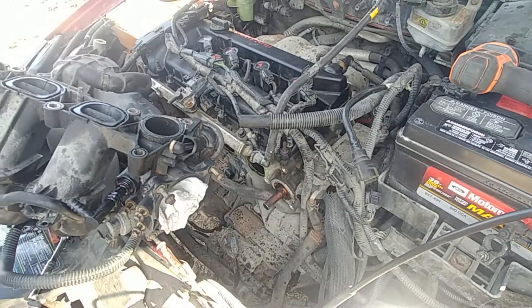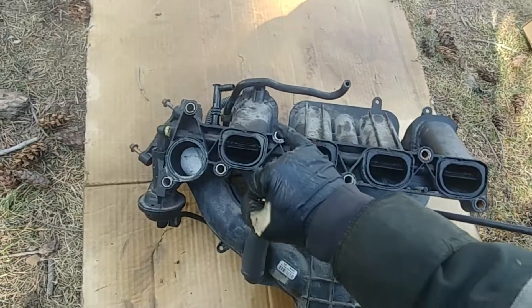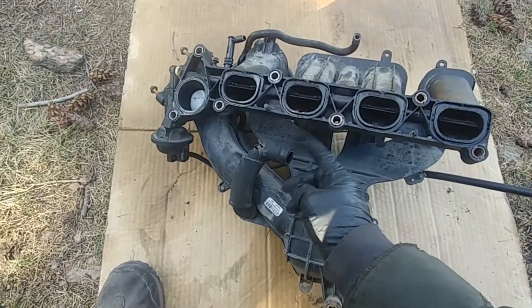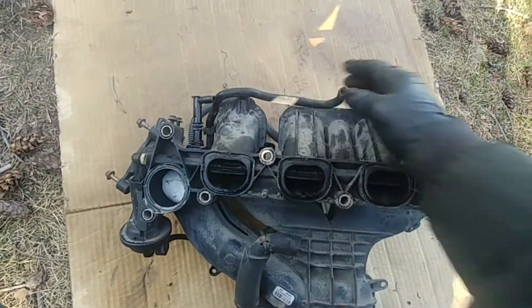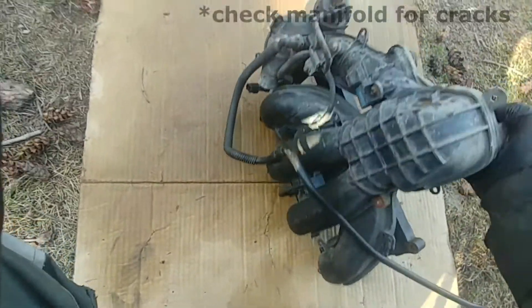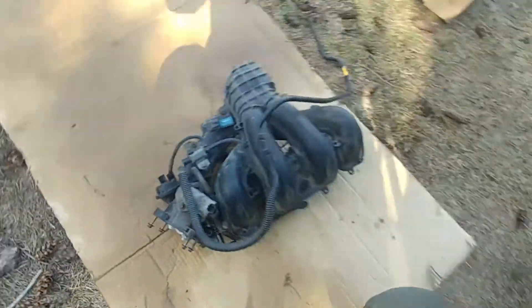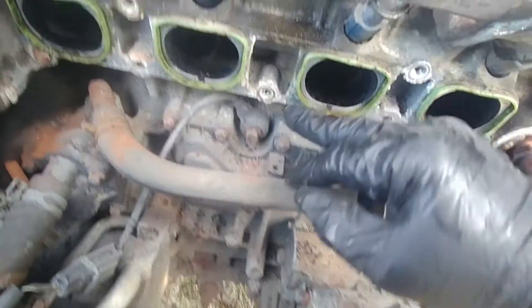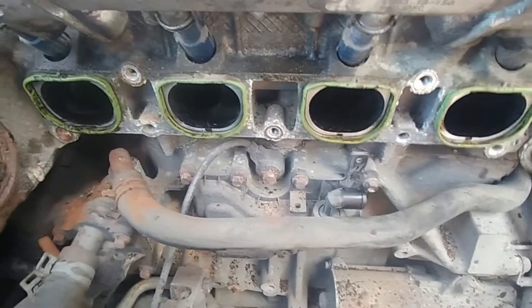This is very tight but you can pull the manifold up and out. On the ground now — all eight bolts were removed. Good time to check the manifold and do a carbon cleanup if needed. There's a hose, flaps to check, hose lines, connectors on the other side, a bunch of sensors, the actuator, and the PCV. Everything on this car is under the manifold.